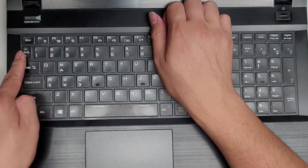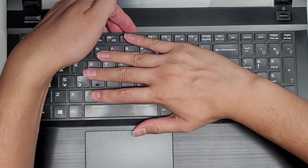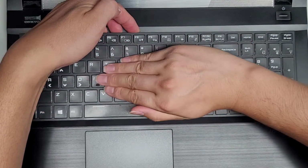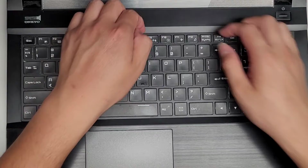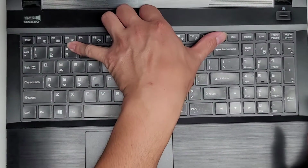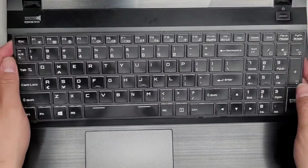And then there are also clips on the side here, so usually it helps to lift the middle here so that it raises, and the keyboard will kind of bulge out that way, and that causes it to pull these side edges inward so that the clips release. Okay, as you can see, I kind of just pull it like that. That causes it to bow, and that releases these side clips here.